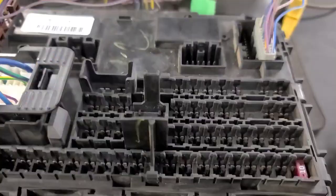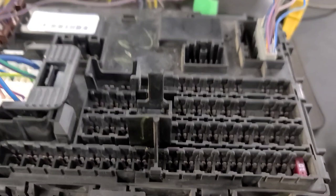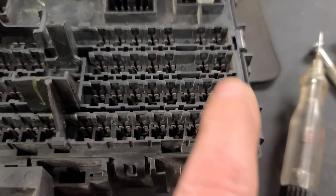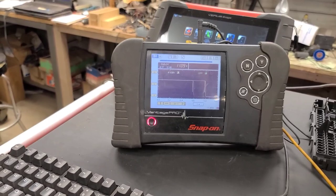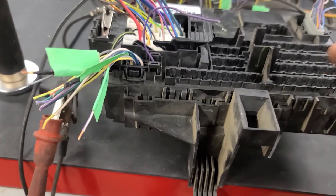There's also a 30-amp circuit breaker in here — I'll pull that out too because I don't think that has anything to do with it; I think that's for power windows. With that main 30-amp circuit breaker out and only this 10-amp corner fuse installed — which I'm not sure which one that is — it supplies voltage to the hazard switch circuit at 11.09 volts. Checking the door lock switch circuit: 11.09 volts. So obviously there's some type of supply voltage source inside this BCM that has failed.